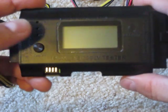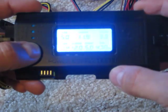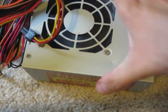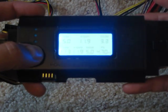Then you hit this power button. This power supply tester is going to turn on, and the power supply should also come on. As you can see, it's running. If everything checks out, it'll just turn on — I'm waiting for the camera to adjust to the setting — it'll show all your voltage. Everything checks out, no beeping. We're all good.